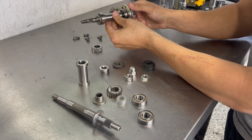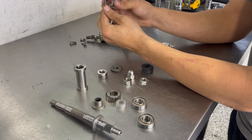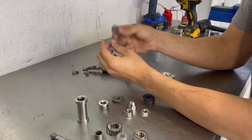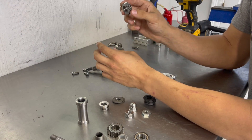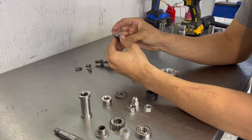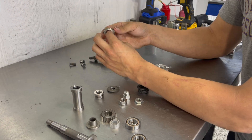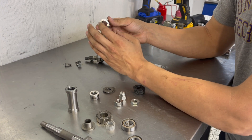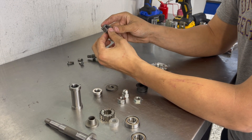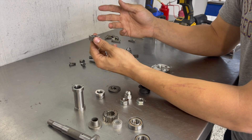Before I get to assembling this we're going to look at the shaft that I just pulled out. I already disassembled it to take a closer look because this supercharger suffered from a broken gear. Now for a maintenance free supercharger that's not rebuildable, this is obviously not a good sign. This gear doesn't have any teeth left on it. It has signs of slipping an excessive amount, and I've had some where the slip was not set properly and it slipped way too much — the gear was discolored from heat. This one doesn't have any discoloration, just excessive slipping wear and obviously broken teeth.